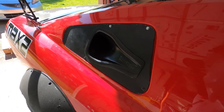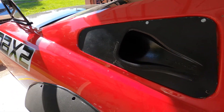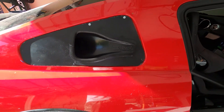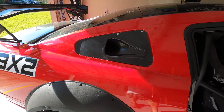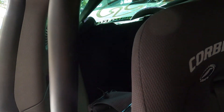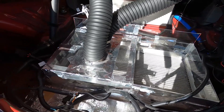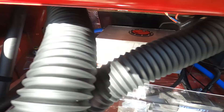After putting it all together and running a few events with the real NACA ducts, two ducts is almost enough — my intake air temperature was plateauing around 150 degrees, which is too high, but that was after 20-plus minutes of running. I think I need to roughly double the current airflow, which is unfortunately going to require cutting some more holes in the car. But the car already has a lot of holes cut in it anyway, so what's one more.